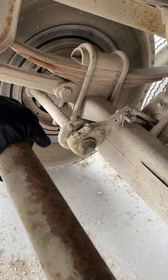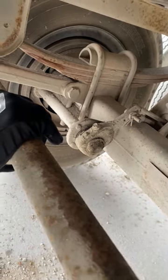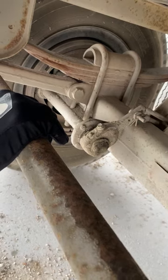Brake drum — two things: no fluid on them, no heat stress. Not bent, broken, or cracked, properly mounted, and secured. Inner rim — no illegal welds. Not bent, broken, or cracked, properly mounted, and secured.